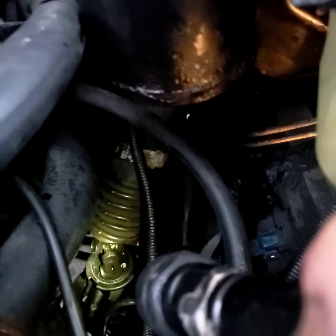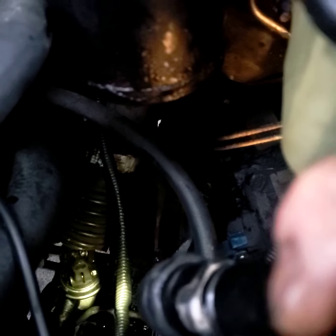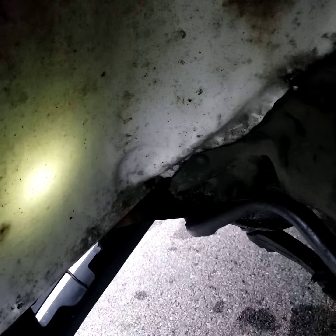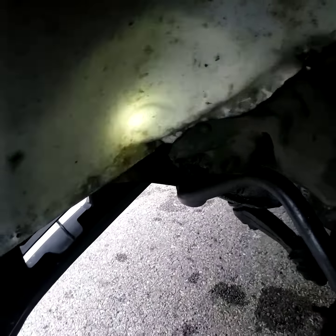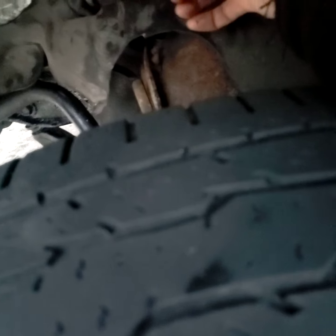and what I ended up doing was I put my pry bar on an angle through the wheel. Well, here. You got to remove this guard here, and when you remove that, leave one bolt, leave the bottom bolt connected, and then on an angle, as straight as you can get it, the long way, with your pry bar pointing upwards on the tip, you'll be able to get it here. You sneak your pry bar, the long pry bar that I used, I snuck it in through here, through the back, and that's how I was able to free it up to release it from the shaft.